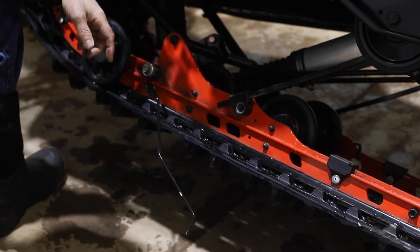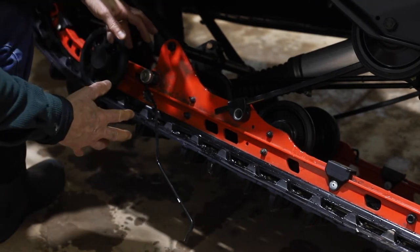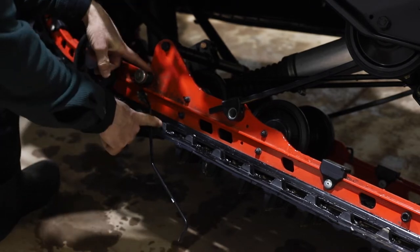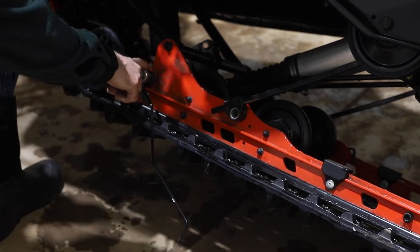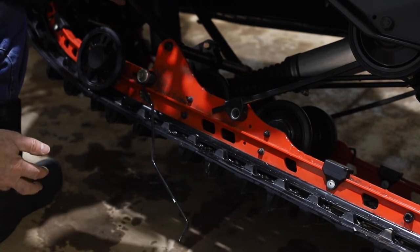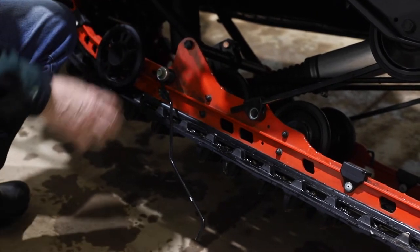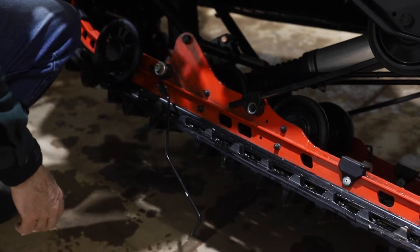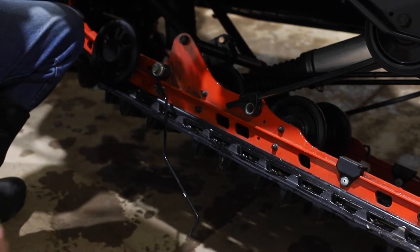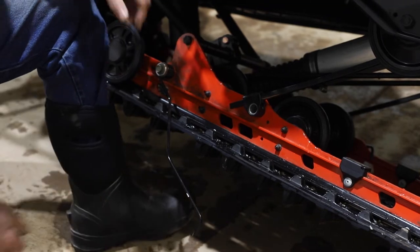There are a couple of different models you can buy. There's one that's basically a piece of heavy steel cable with a carbide tip — you can leave those down all the time because you can go forward or backwards without hurting them. There are also a couple of models that Bombardier sells with a double spring setup, one mounting up here and one on the running board. Those you can reverse on, and they are more expensive. They're probably preferable because it's very easy to forget you have these down. It's best to have ones you can reverse with — everybody forgets, including us. That's why we always keep spares on hand.